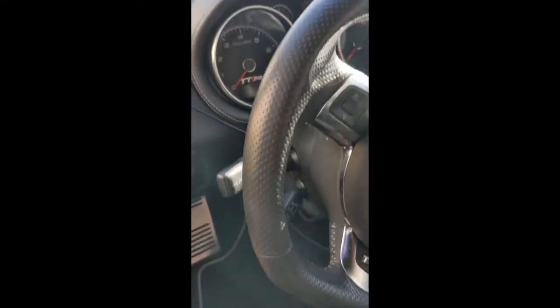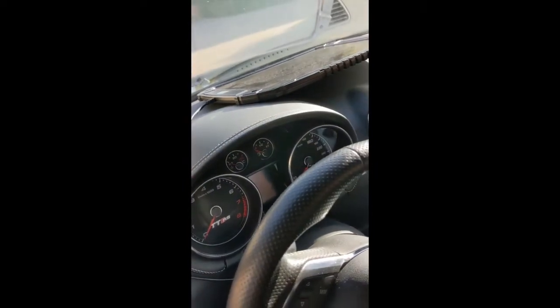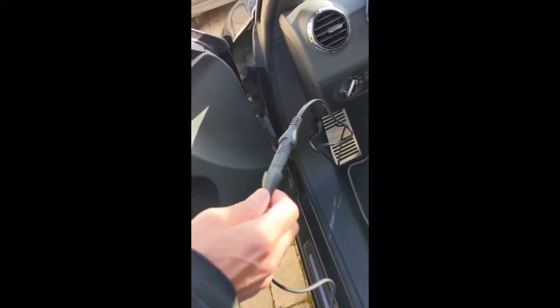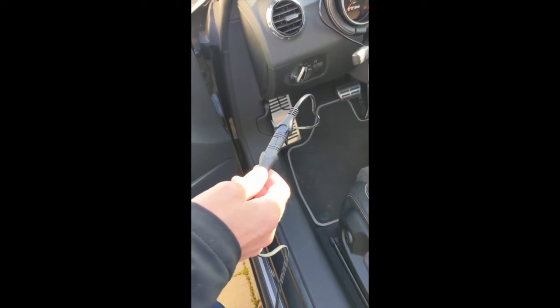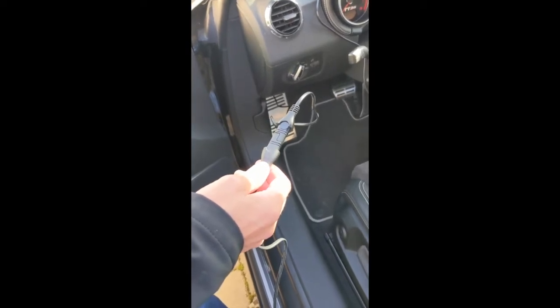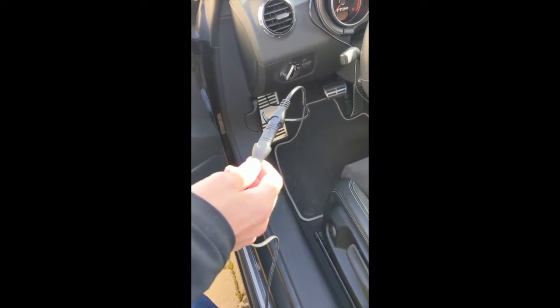This is a picture of the intended connection, which is via the OBD socket. The panel is quite clever — it comes with clamps, it comes with a 12 volt cigarette lighter adapter, and it also comes with an OBD socket connector. So the idea is you can put it under a sunny spot in your car and plug it in via this connector cable into the OBD socket, and it should be able to charge the battery. The pinouts on the OBD connection are guaranteed to go without any relays and be live to the battery itself.